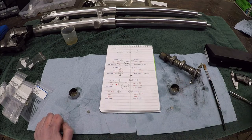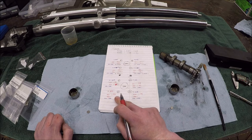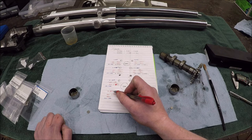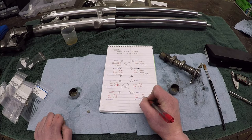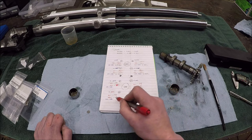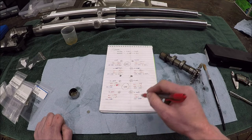So I'm thinking 1.65 on here. If I'm thinking one jump in shim is worth 0.002, so one jump in shim would put me at 0.009. So a 1.70 would put me at 0.009. A 1.65 would put me at 0.011. That's what I want. A 1.65 here and here. I want a 1.65. This one's actually coming from a lower spot, though, so these actually may come out looking pretty similar. The difference between these isn't as big as these two, but this one has more clearance than that one. I think we're going to come out close to 0.011 on both of these. That's what we're doing.